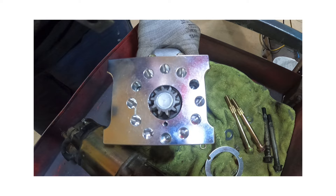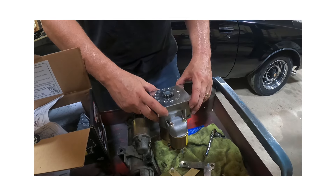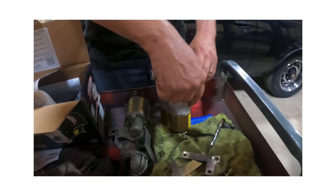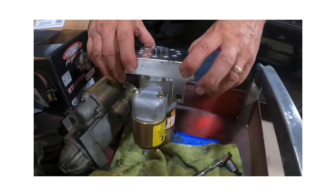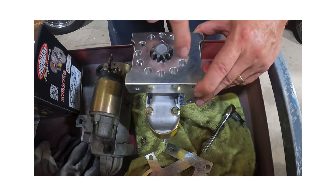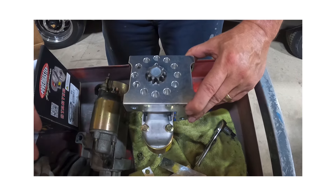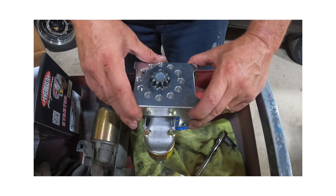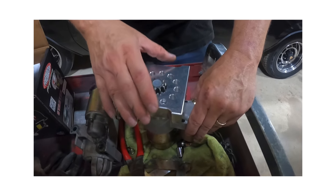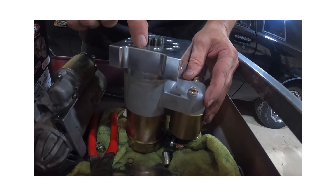We're going to put this in, use our power probe, and see how much clearance we have between the pinion and the flex plate. I'm going to have to clock my solenoid on the mounting block — I was afraid of this. The solenoid is hitting the tapered side of the back of the block so I can't line up my mounting holes. I'm going to have to remove these three bolts and clock the solenoid out toward the right front fender, just one hole because I think that's all I need.